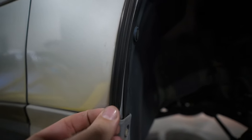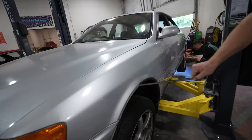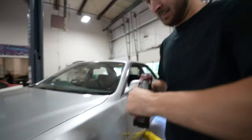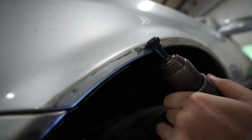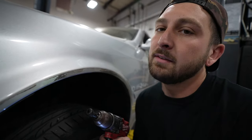I've been dying to take this badge off. What if somebody opens their door near you? So you've probably seen it before - body shops use a big rubber eraser wheel to get adhesive off. Same concept as the eraser on the back of your pencil, just a big wheel on your drill. A lot of guys don't have those and can't find them in stores, but I saw this hack on TikTok. If you own a tire shop you know - it's literally a chunk of rubber, essentially the same thing. Just don't use it on bumpers - only on metal parts. It's working great, better than rubbing your thumb raw.